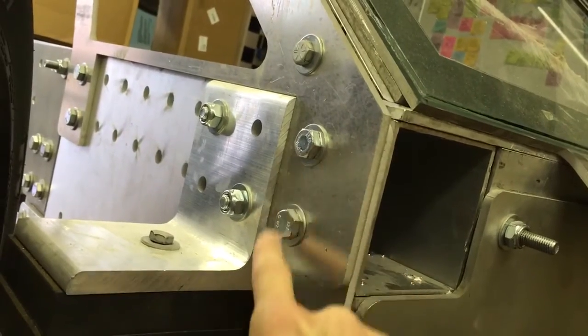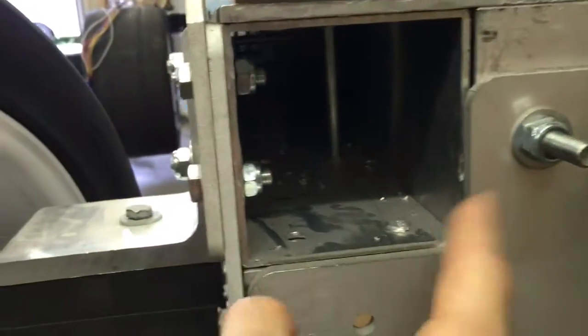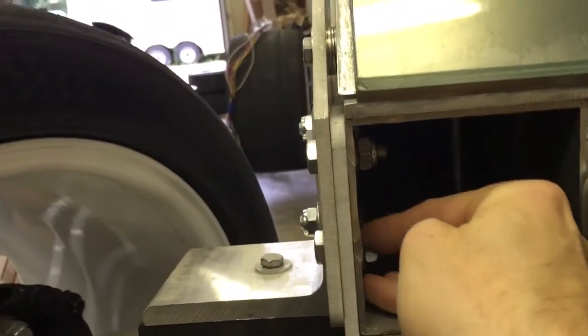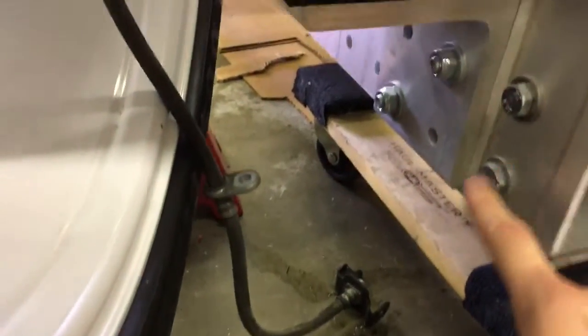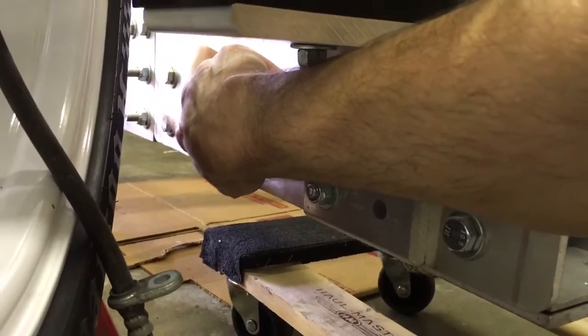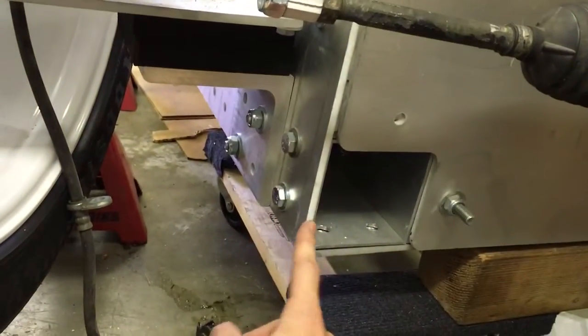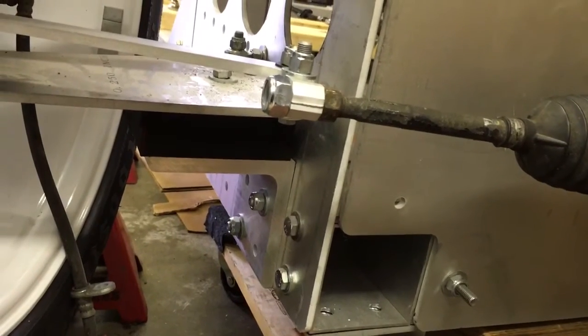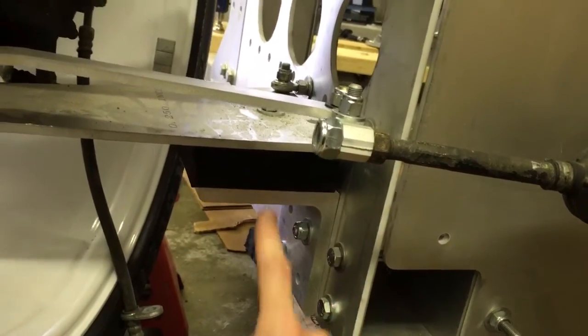Now we can attach the suspension mount plate to the car. There's going to be a bolt in the outer foremost corners with washers. We have a prototype windshield on here — you won't have that part in most other cars, so you can ignore this, but the bolts are in the same place. They go right through to the chassis. To tighten the back of them, put a wrench on the inside with a washer on the inside and the lock nut on the inside, and just reach your arm back with a wrench to get the back holes — they're in the rearmost two holes. Now the front of this is flush to the front of your chassis and the bottom is flush to the bottom of your chassis, so if you have to drill these eight holes to attach, that's how you do it.